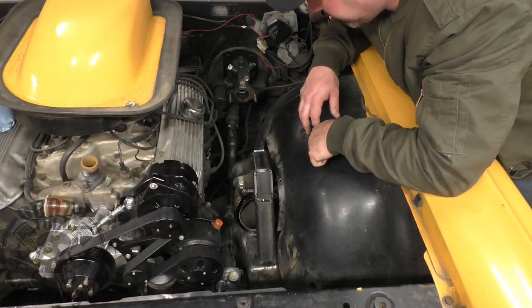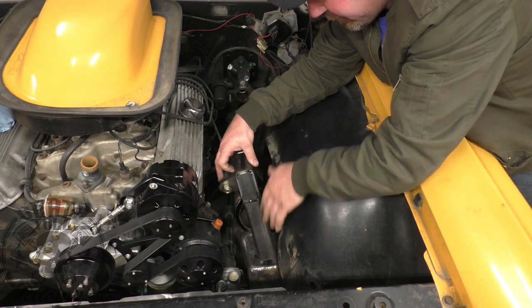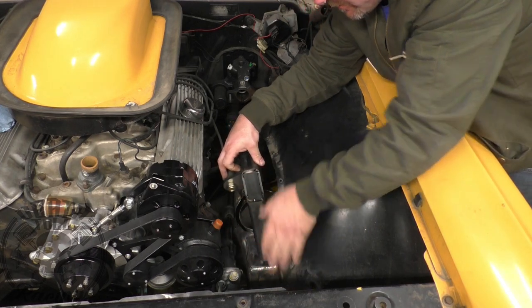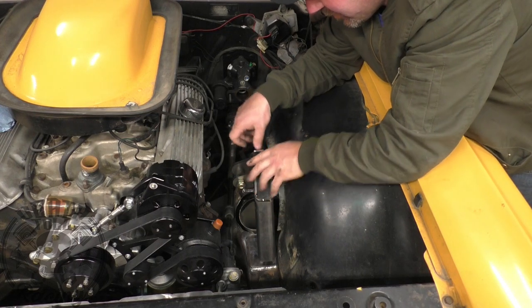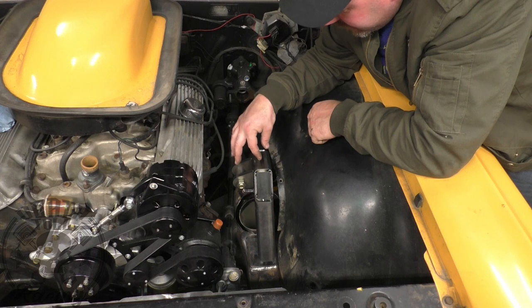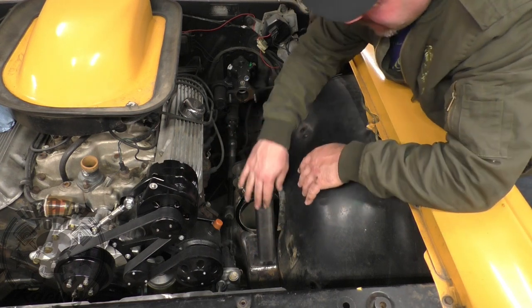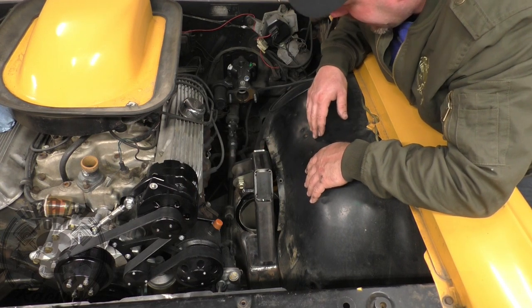Here's what I came up with. It's just a two-inch quarter-wall tube coming up 30 degrees — that miter is a little greater than 30 degrees because the frames are going down — going into a two-by-three quarter-wall rect tube. Once I weld it, it should all flow together, and if I grind it real good you won't even be able to tell where one starts and one ends.